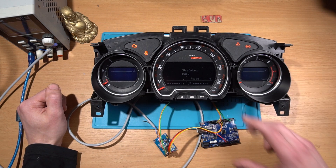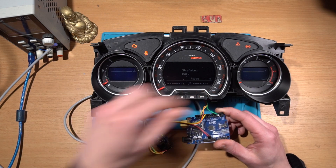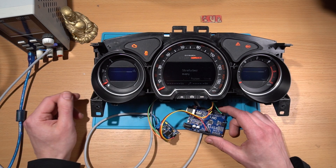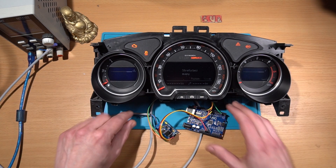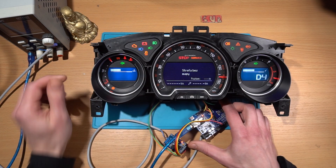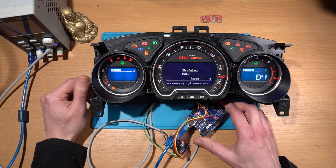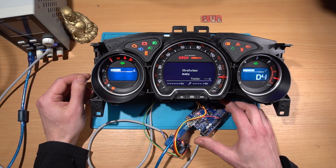So how can we do this for cheap? First thing: Arduino Uno. Second thing: MCP2515 module, and some code that I will provide in the description, or if it doesn't fit, I'll pin it in the comments. When you power up the Arduino, it listens for the mileage from the cluster. It won't get it if the cluster is already on. I'm also sending values for the other gauges just to see if they work.